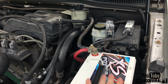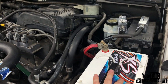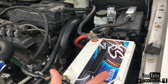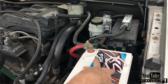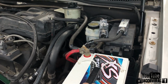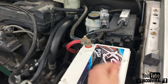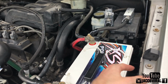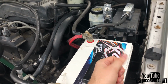So going into wattage power rating versus AGM battery capacity, there are considerations you need to make in your selection. What I mean by that is, if your battery is rated at 100 amp hours, I normally go by an 80 to 120% range of efficiency on your battery. So for every 1,000 watts, 800 to 1,000 watts should be an 80 to 120 amp hour battery. So realistically, every 10 amp hours of AGM battery needs to be 100 watts.